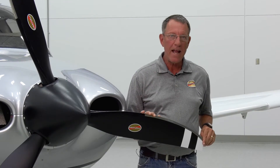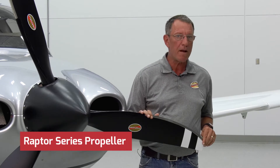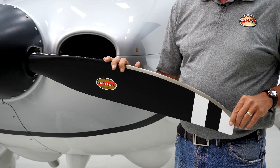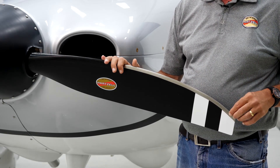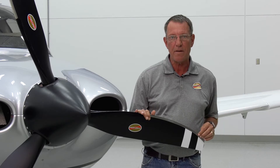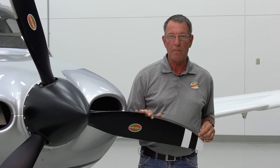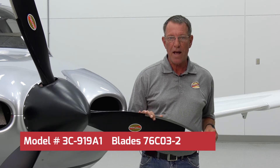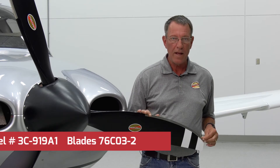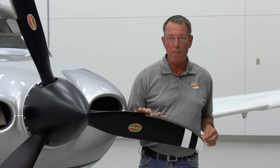Good morning. Today we're going to be learning how to perform a pre-flight inspection on a Hartzell Raptor series propeller. This propeller is a completely new design. A Hartzell propeller that you'd be used to doing an inspection on would normally have HC in the model number — maybe a PHC, EHC, DHC, something along that line. This Raptor series propeller has a different model number: 3C-919A1, and the blades installed are 76C03-2. The pre-flight inspection on this propeller is slightly different than a Hartzell propeller you may be used to.